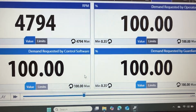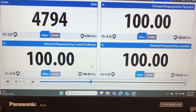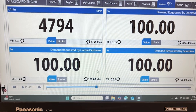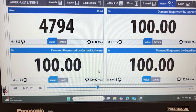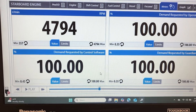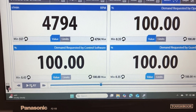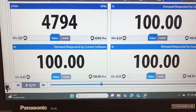This is the second run after fixing the hot foot so that the throttle was actually giving me 100%. I'm going to run this through so you can see it actually hits RPM. I also changed the prop from a 23-pitch Tempest Plus to a 22 Tempest Plus because I thought I needed to get more RPM out of this engine. This will be a good prop for break-in — I believe that once the engine is broken in, it can then go up to a 23, maybe even a 24-pitch prop. You can see all of my numbers are hitting 100% and I'm asking 100% in this corner.